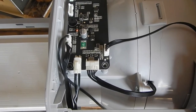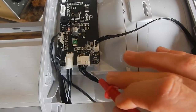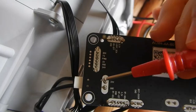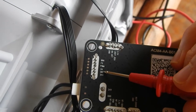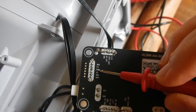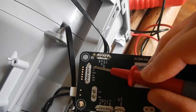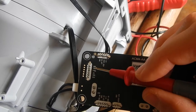The ultimate thing I'd like to do is control the fan via this 6-pin interface. The 6 pins are: 24 volts, ground, 5 volts, the PWM signal, FG (which I'm not sure about), and BRK which is the brake or something. I don't know how to emulate or hack this to control the fan efficiently.